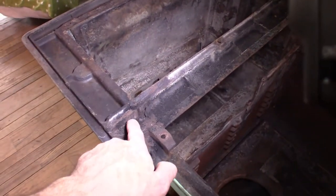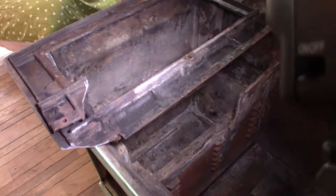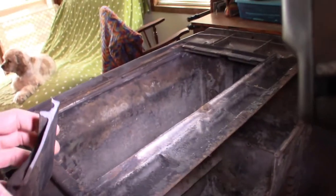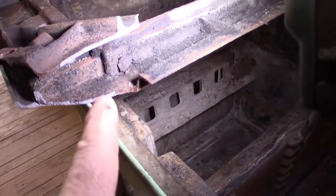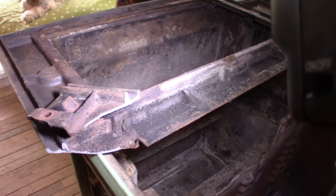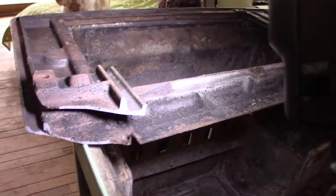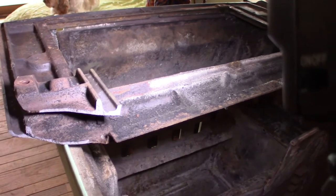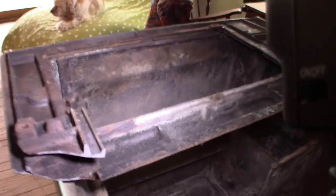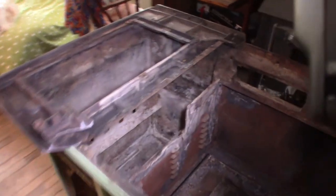I'm thinking about maybe drilling into these little flanges to give the epoxy somewhere to bite onto, and getting this all cleaned up well. You can see here we've got a fresh break and an old break — so this was already cracked before I broke it. This corner and this corner are an old break, and this is the fresh break. That's probably why it broke when I was pulling on it. We'll drill into this wall and into here just to give the epoxy somewhere to bite, and fill that in with epoxy. The stove might get 600 or 700 degrees, so 2400 degree epoxy should definitely be a plus.